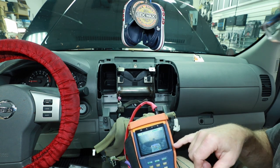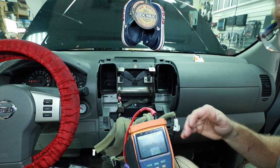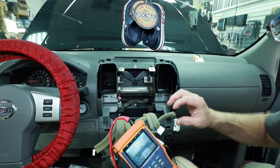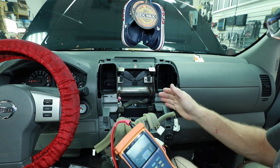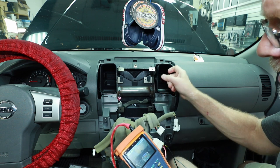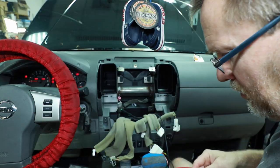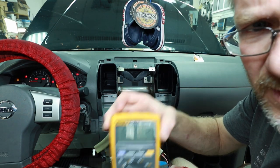We can also see it's some kind of a handle cam — it's mounted off center, which is not the end of the world, but the customer has to be made aware. When retaining factory cameras, sometimes they're not going to be in the same place they were on the factory screen, because the factory screen will actually crop and move the image. Anytime you go to replace a radio with a factory cam, if the camera is not dead center, chances are good it's going to be off on your aftermarket screen — left or right depending on where the camera is positioned. If the camera has adjustable backup lines, you can use those to center it. Also on this harness, we have this green-purple wire, which should be our backup wire. To test it, one end of a digital multimeter to ground, put it in reverse — we got 11.8 volts. Put it into neutral and it goes away. That confirms this is the reverse trigger.